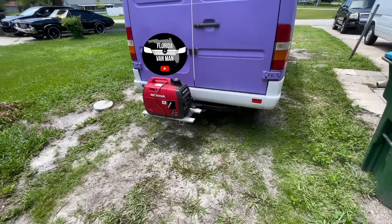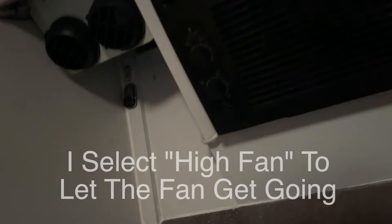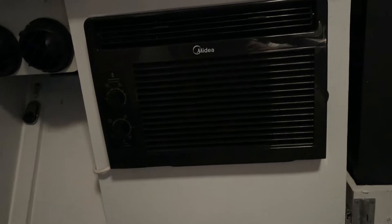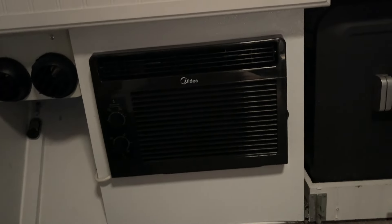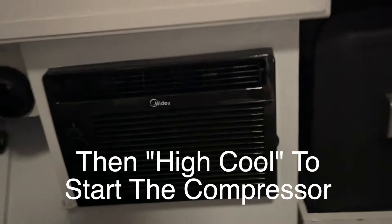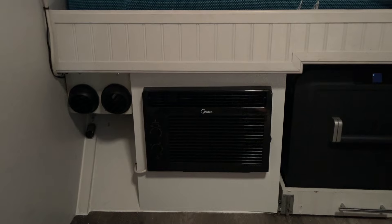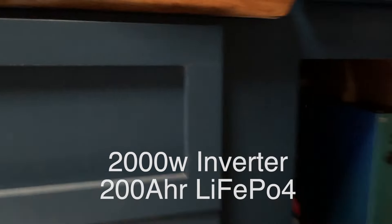The generator is offset so I can get in and out of that back door. The inverter is on. This van's only got a small battery and inverter system — not really enough to run air conditioning long-term. It'll cool the van down and run a couple of hours, but it'll take a couple of days to recharge the battery from that much use on the air conditioner. Of course you want that battery for the refrigerator and other appliances.